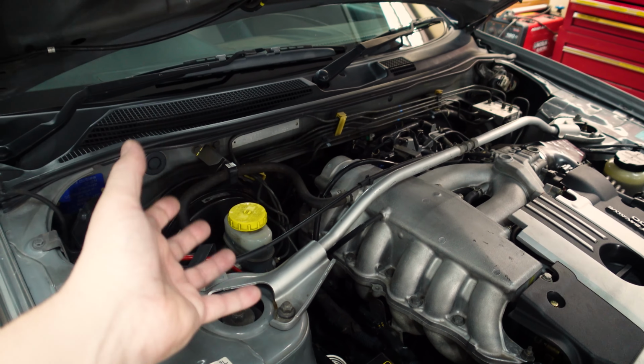And the reason I say this is not as simple as a lot of people make it out to be is that if you just do a standard thing of dropping the drain plug on this thing and then taking the sump off and swapping the filters over, you're only going to change out about 2 litres of oil or somewhere thereabout. And that's because obviously we have an amount of fluid in the sump, and if we were to drop it, we'd get rid of that.